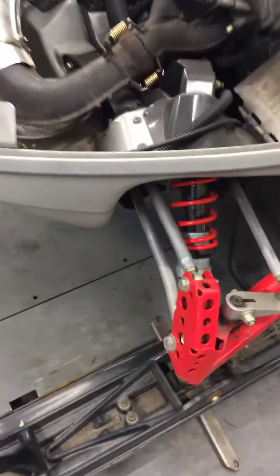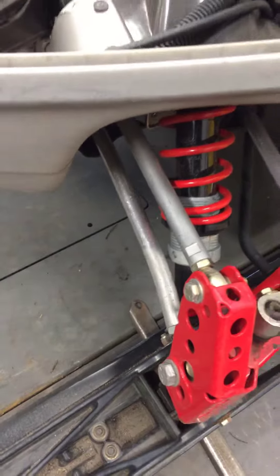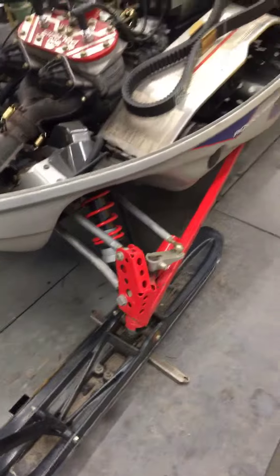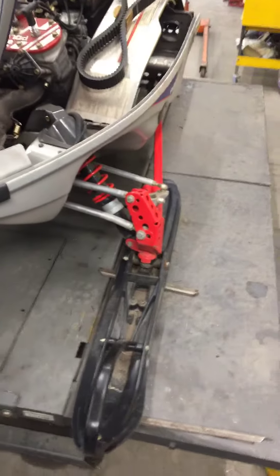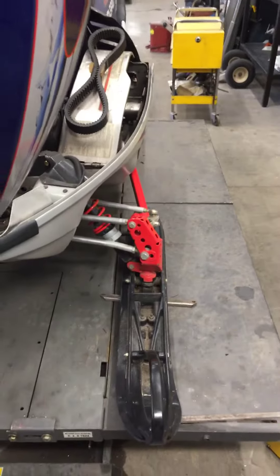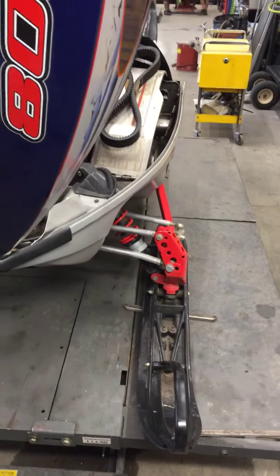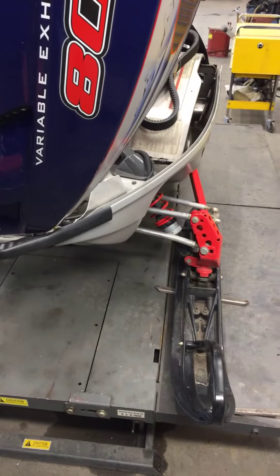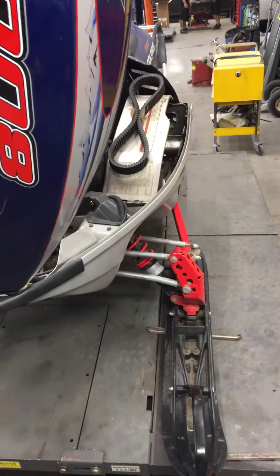My only other finding is I've got a little bend in the lower radius rod. There's enough adjustment between the upper and lower radius rods that I can get the camber set correctly on that ski. I don't think there's really any drawbacks to running it this way. If you were racing it, it would be a different matter, but if we're just looking at something to ride around on the trails and that sort of thing, I think this isn't going to bother you a bit.